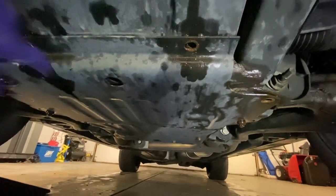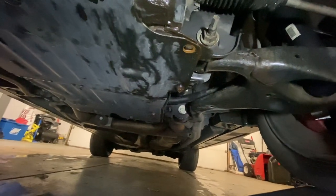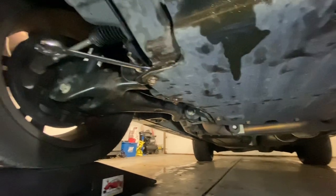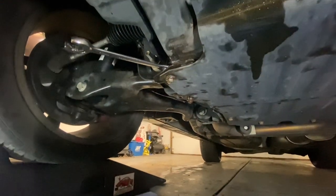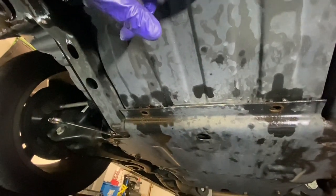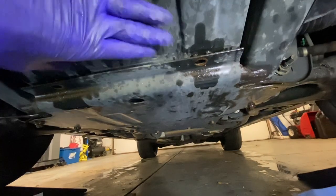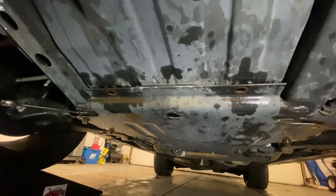I've removed the first two bolts here — they were seized up pretty good. These are removed with a 13 millimeter socket and a breaker bar. I had a little bit of an issue with some of them and needed to put a wrench on the back. I've done this job before on another Range Rover and that wasn't the case, but nevertheless we should be able to get this plate off. There's another plate here — the only thing holding that on after you remove the major plate is two smaller bolts. This larger plate sits underneath that one, so it will be the last to come off and the first to go on if I need to remove it.